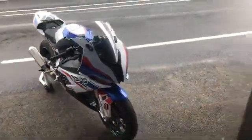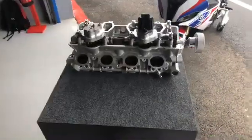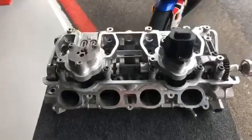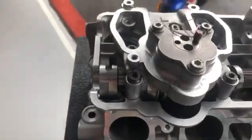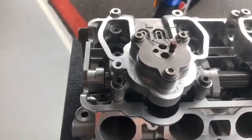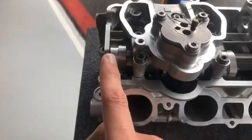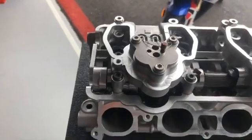It's a pre-production model but I thought I'd do a little video. You've been hearing a lot recently about the shift cam technology that's in the new engine. So this is the cylinder head with the camshafts. Now if you look at the camshafts here, you can see — anyone with any kind of engineering knowledge — there are two lobes here and here. One's basically a soft cam and one's a hard cam. So one's for low revs and one's for high revs.